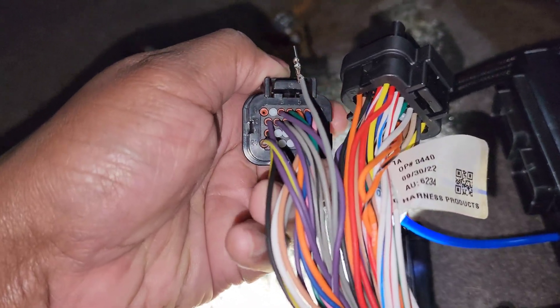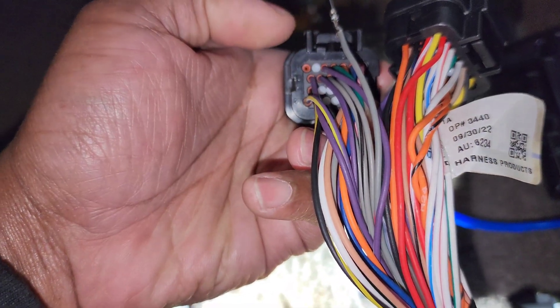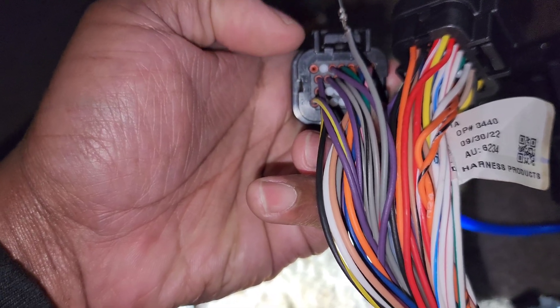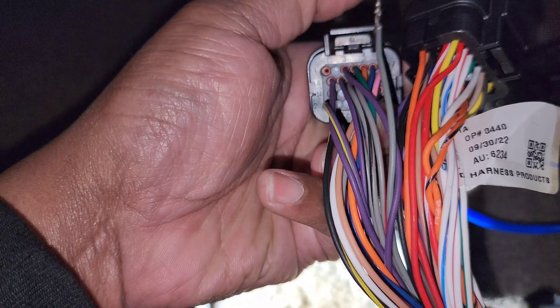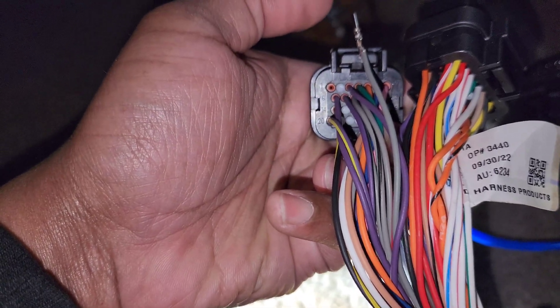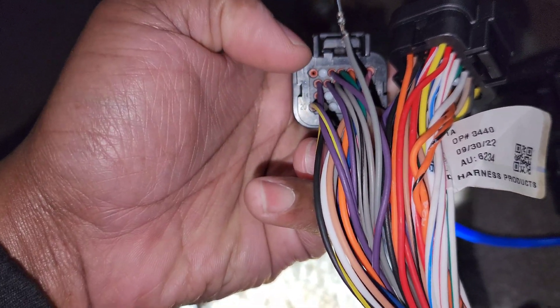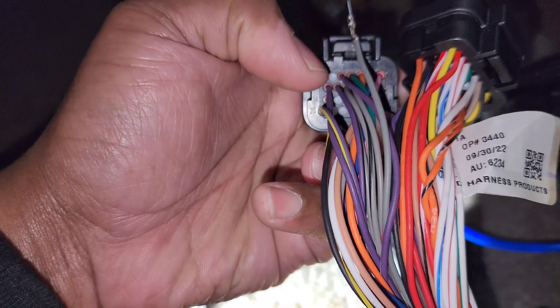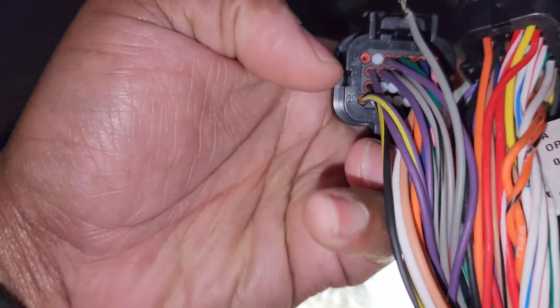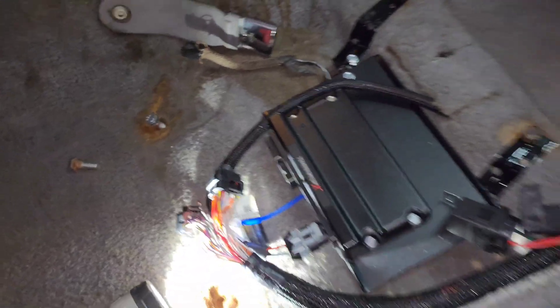So I'll tell you what you have to do in case you have the 937 kit and the Ford IAC. In your pins — one, two, and three of your J-block — you remove pins one, two, and three. Pin number three is the gray pin which doesn't get reconnected back in. Pin number one went to the number three hole, and pin number two went down to J20 at the bottom. That covers the ECU side.